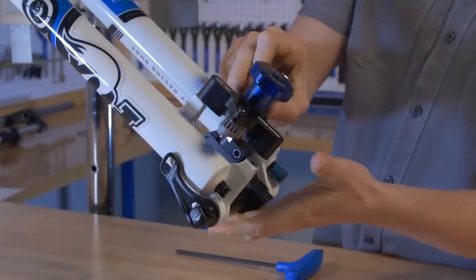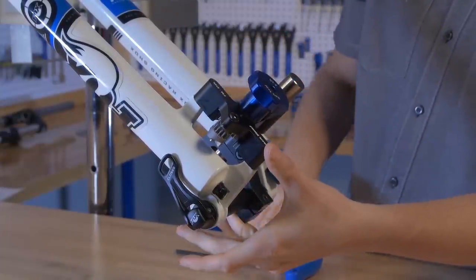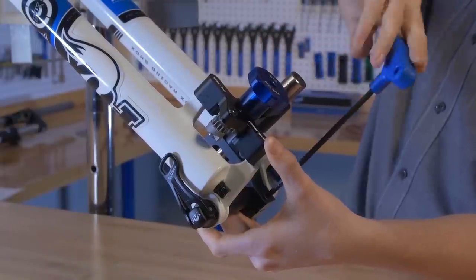Slide the body left to right on the axle so that the cutting arm wings are over the post mounts. Rotate the body so the wings simultaneously contact the post mount surfaces. Tighten the pinch bolt to lock the body on the axle.